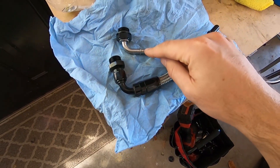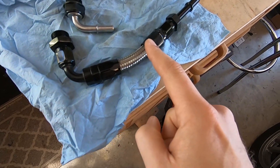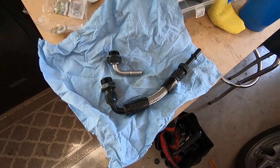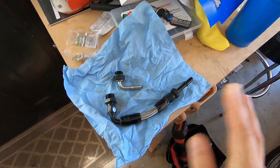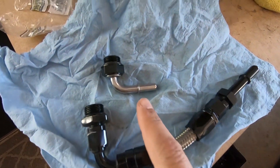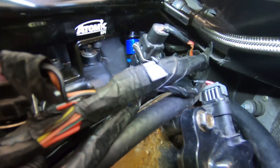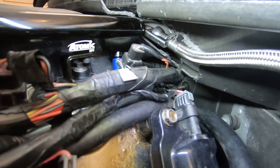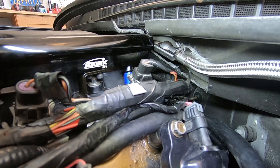Here's a good example: the new setup has one connection, two connections. The old setup had one, two, three, four, five, six, seven, eight connections. So we've gone from eight down to two. This was fine before, but I'd rather have the least amount of potential leak points. You can see in here — the OEM flex line goes into that Earl's fitting and straight into the fuel rail, which is great. We even used the OEM safety holder clips too.